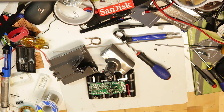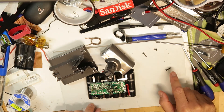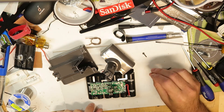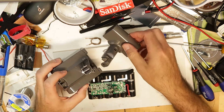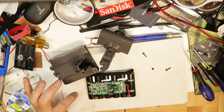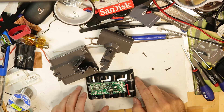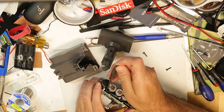Hi, Dyson V6 battery. I've already opened the battery - it's not very complicated. There are two screws to take off from the Dyson itself, and then you have another small screw on the top. Then just a few clips - you should use a flat screwdriver. Always be careful, and make sure the batteries are almost discharged because you don't want to short. Then you have protection from the contacts on both sides.